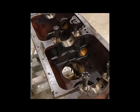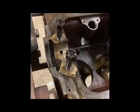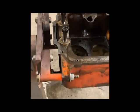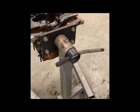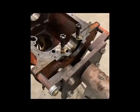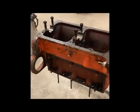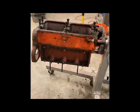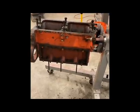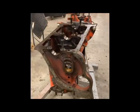Really the only two things left on the block are to pull the cam bearings out and then power wash it, and at that point we'll just be waiting on parts. I do have the rear seal to replace, so we'll be pulling that off. There's a really nice video on YouTube on how to do your pan gasket and felt seal on these — I've watched it and I'm going to follow that procedure. Anyway, appreciate you watching — hit like and subscribe and stay tuned for the rebuild on this Allis Chalmers WD 226. Leave a comment if you've got any questions and we'll follow up until next time.